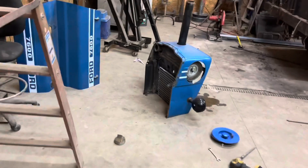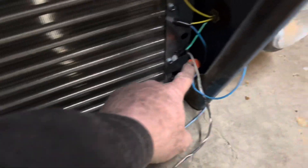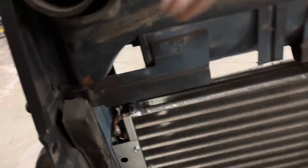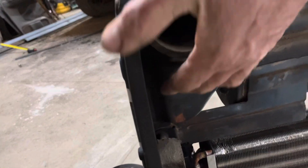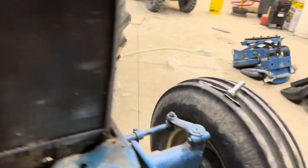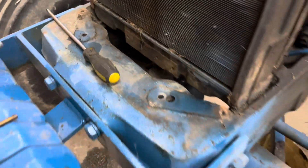On the condenser — here's the condenser, it's in there. I've got to make some brackets to mount it, but it barely fits, and that's what it's supposed to do. The condenser down here — I've got one fitting coming out, just get it straight for that, and I'll probably get a 90-degree for this one to go up. Then I'll come out — I want to drill holes and come out right below this air filler line. I have to relocate the oil cooler in front of it, so I've got to redo these lines. The oil cooler lines are right there — you can see them. I'm going to bring these lines up here and along here in the same area and down, because the condenser is going to cover up where they used to be.